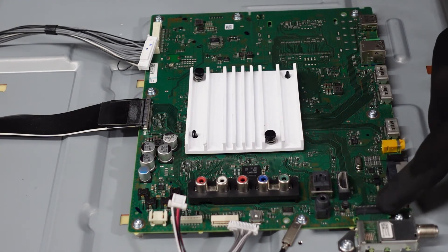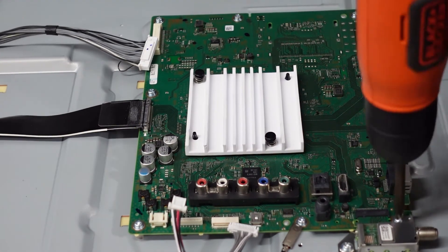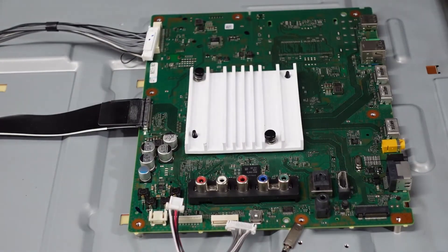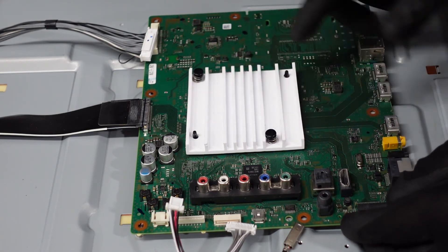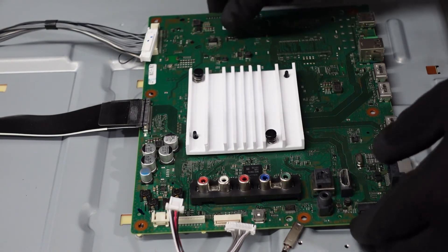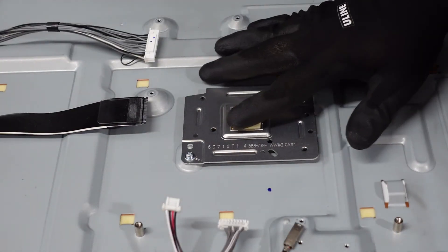Keep in mind that this little coax is its own separate piece, so once you go to lift this board up, it's going to probably fall off — just keep that in mind. You're going to lift up. There is some adhesive underneath it here. Always be careful when you're removing boards so you can see if there's going to be any resistance. And there we have our main board.